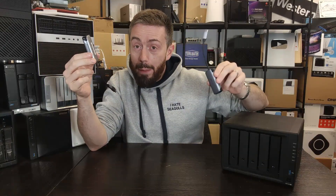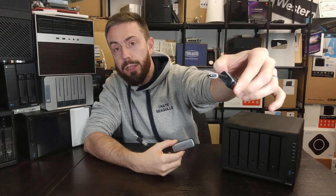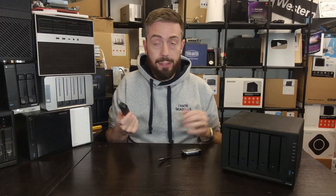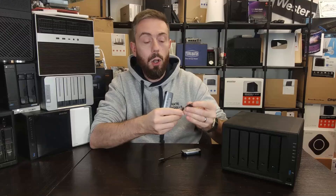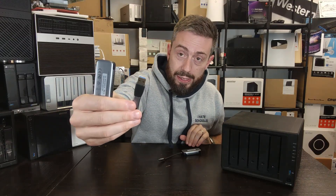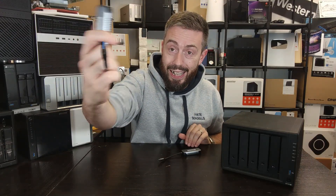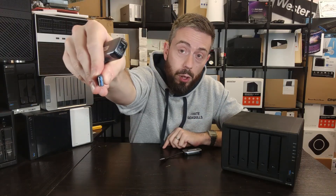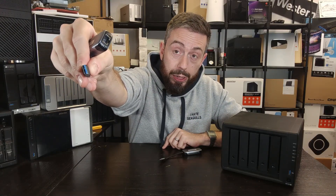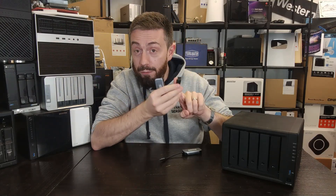Lastly, although this adapter I have here is from a review filmed about a week ago, it's worth bearing in mind it's a USB Type-C adapter, and very few Synology NAS devices at the time of recording have USB Type-C. However, it's very easy to get USB Type-C to Type-A adapters for about a pound online, which will let you use this USB-C adapter on a USB-A port. Just make sure you get a USB 3.2 adapter so you don't bottleneck the speed — it might cost an extra pound or two, and I'll try to link one in the description.